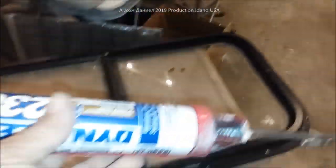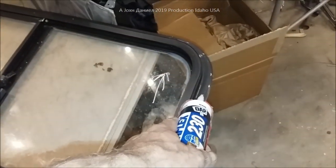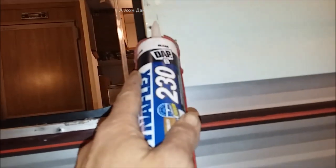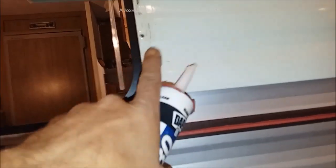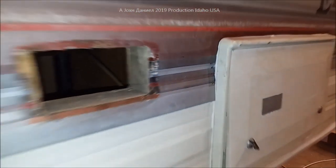The windows have been completely cleaned and we're going to put a nice big bead of Dyna Flex around these. What I do is I'll put a decent bead just this side of the screws, and then up here at the original screw holes I will put it on the outside. There's still a little bit of residue left but it'll go on there hard enough and deep enough to seal up and squish out, and then we'll clean around it just like I did right there.